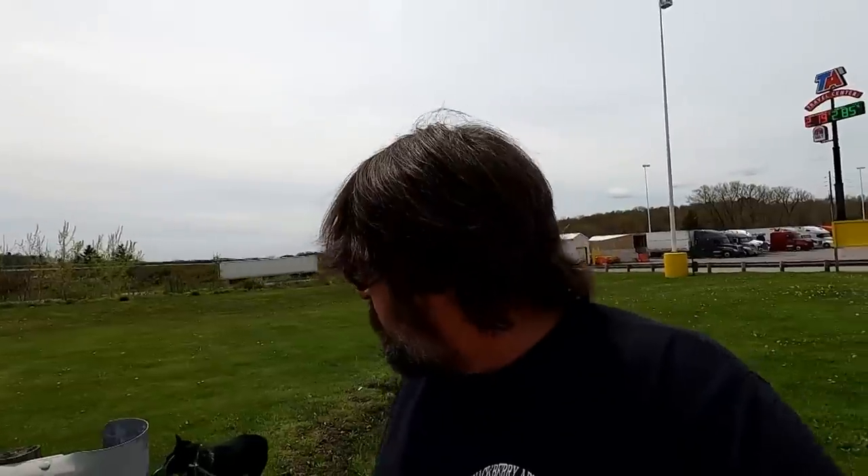So the Bounder - for right now it has to do with the airbags and the tire pressure, and it's not gonna stop there. I've ordered some other suspension parts and we're gonna give it a good overall suspension tune-up. Parts are ordered and won't be in for a few days. I've made an initial adjustment of backing off the tire pressure - I had been running too much. I've corrected an issue with the rear airbags and I'm just going to replace the front airbags - they're basically disintegrated.